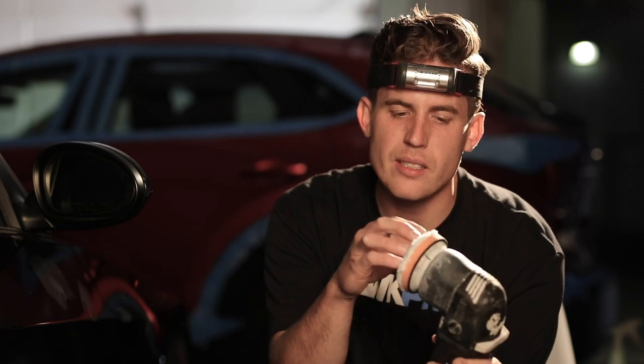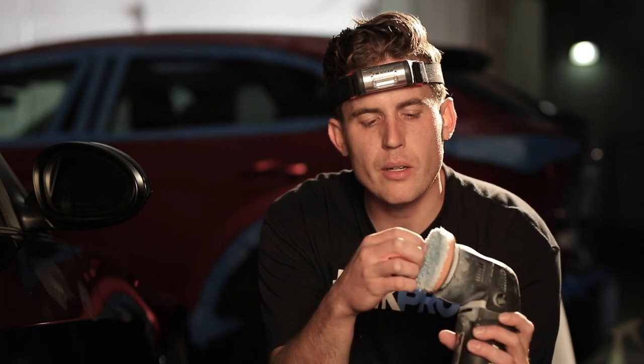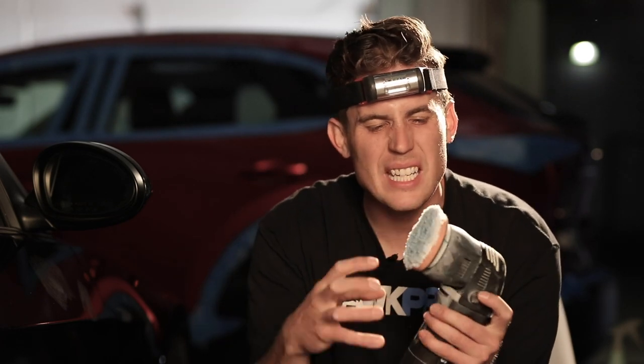I do want to show you what I'm doing to remove what looks like a crazy blemish — this white residue. I'm just going to hit this with compressed air. Don't be afraid of this blue — that was from a single stage paint job that was blue paint, so it stained my pad, but the pad's perfectly clean. I like this Oberk pad; it's got a little bit more of an interface to it so it's not as aggressive. What I like over a Meguiar's cutting microfiber is the strands are longer, so it can take more polish, compound, and residue and keep on trucking. Because I have a mini and it's such a small pad and it clogs up really fast, I like having more fibers.